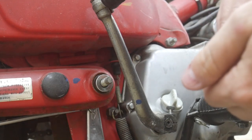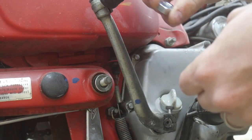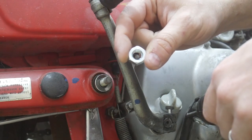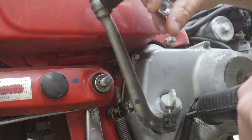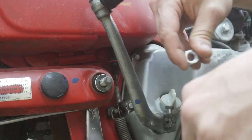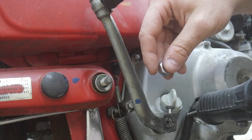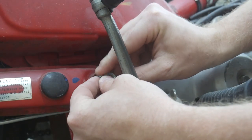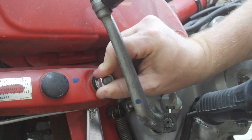Next day - 10mm hardware apparently comes in three different thread pitches. So I bought the other two remaining ones. The one I had was a 1.5, and they also make it in 1.25 and 1.0 - I'm guessing that's threads per millimeter. I'm not going to install the bracket right now because I'm waiting for that muffler, but I want this swing arm bolt to stay in place. So I'm putting a lock washer down and going ahead and tightening a nut on top of that.